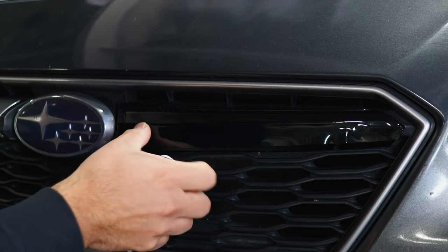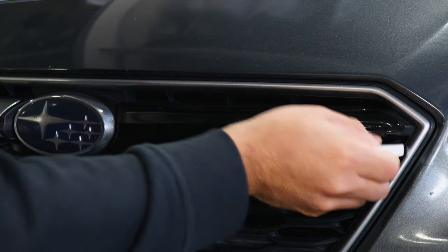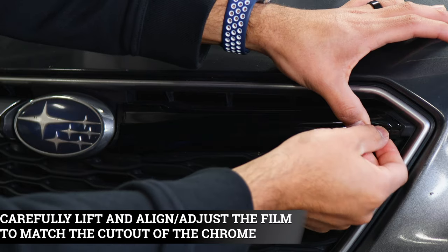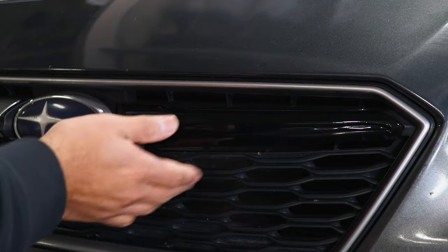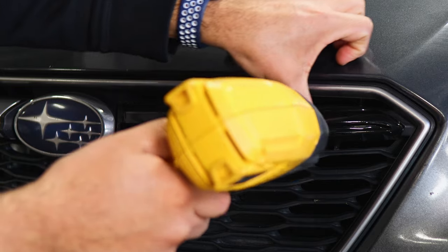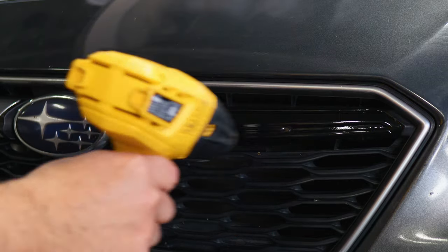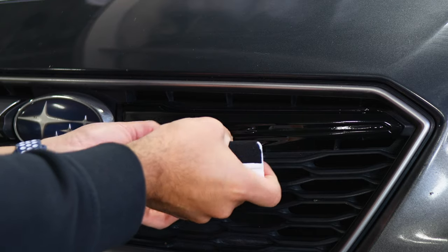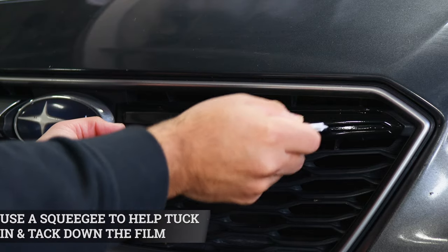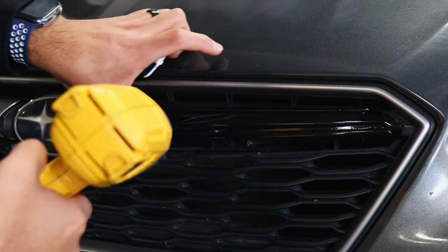Secure the middle section by first applying a little bit of heat so the film starts sitting on this section, then tack it down with your squeegee. Once tacked down, help it wrap underneath — you can always lift it to realign and readjust. Apply heat to help it sit underneath the panel and around the curve, then squeegee out all the air so it sits flat. Bring the film down inside, lifting as needed to release any trapped air, then tack it down slowly to cover the lower section, applying heat and using your finger.